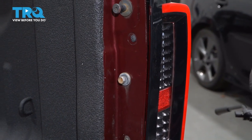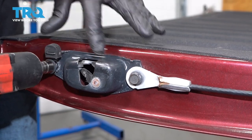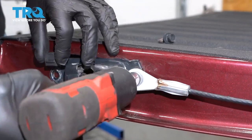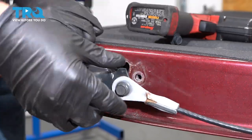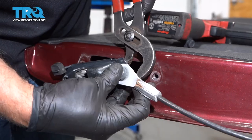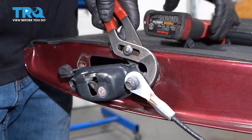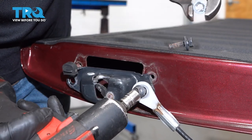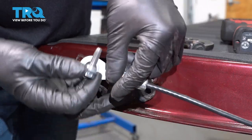I still have one of these straps on the other side. Now we're going to take both of these bolts out using a 13-millimeter socket. This bolt has a cage on the other side of it — a little washer that holds the bolt in. I'm just going to use some pliers and hold that washer. Take that off just like that and separate it.